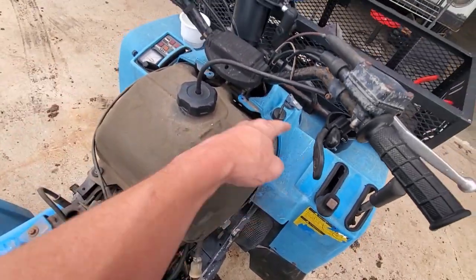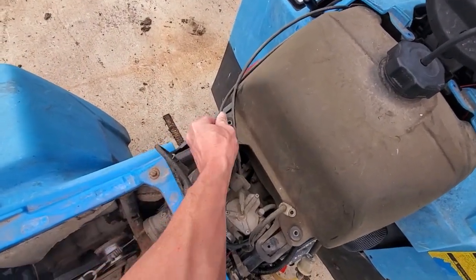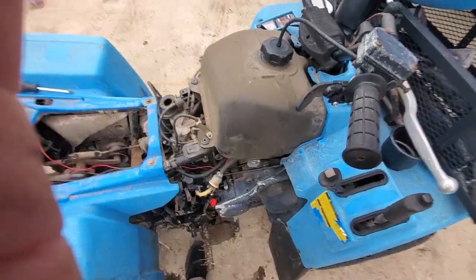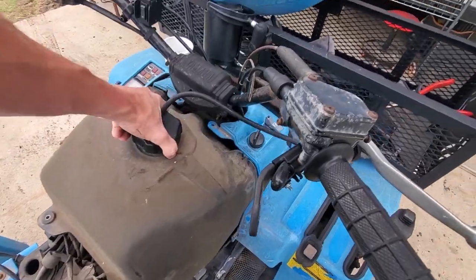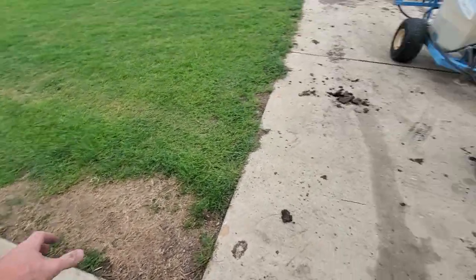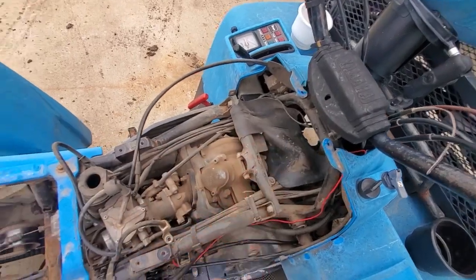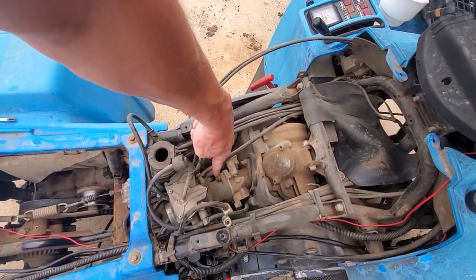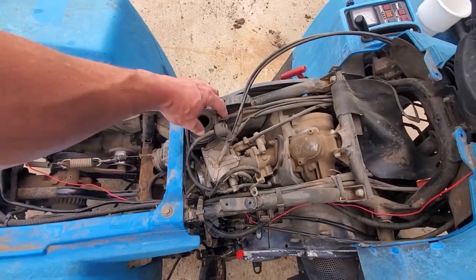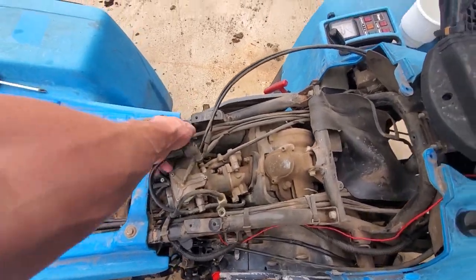Okay, let's get this off — I've already got the two front bolts off and the rear bolts off. I have to push this cable around this back part as I'm lifting. Let me set the camera down. Okay, fuel tank has been removed. Push this up — now I'm going to these two inner bolts, the ones attached to the carb. I'll keep them on — it'll come off as one assembly. Let's free up a little bit more space.